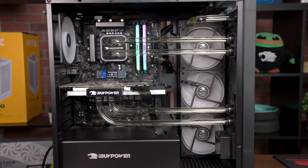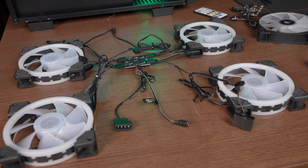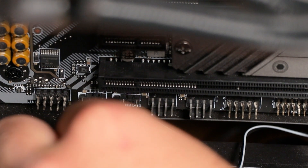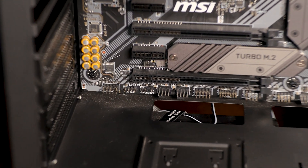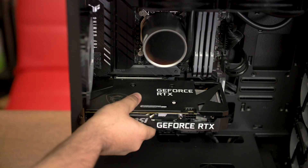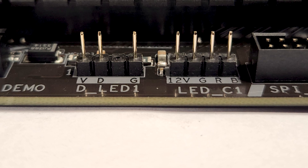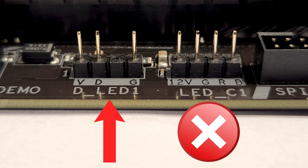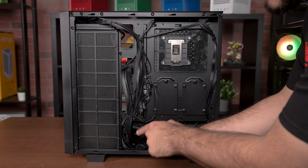If you find that none of your fans are lighting up, then it is more likely that the hub itself is either disconnected from the power supply or the RGB signal. If all of the RGB seems to be properly plugged into the hub itself, check around the motherboard side to make sure the signal header is also plugged in properly. In some situations, this plug may be in a very hard to reach spot on the bottom edge of the motherboard, so we recommend removing the video card to make access easier. When attaching your RGB cable to the motherboard header, take care that you are plugging into the 3-pin 5-volt header, not the older 4-pin 12-volt header, as this could cause damage to the system.